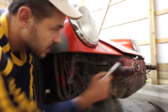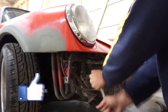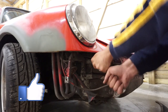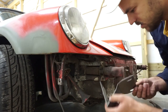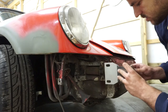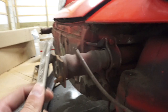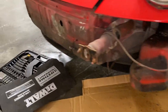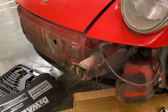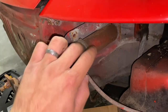We're going to take off this front impact tube. We got the one side strap off. I'm pretty sure we might have to remove this and then the bumper can get fitted once again. I got the one impact absorber off that side - it was pretty simple, just those two bolts.